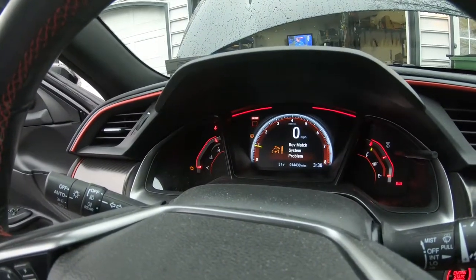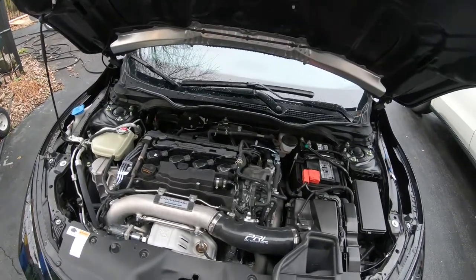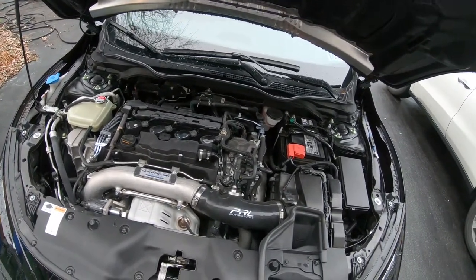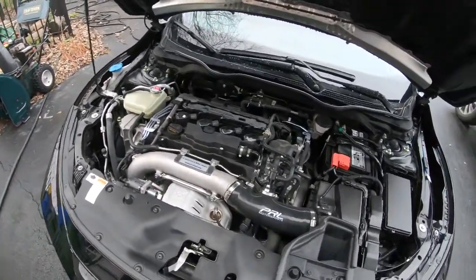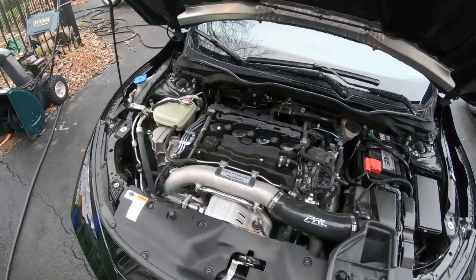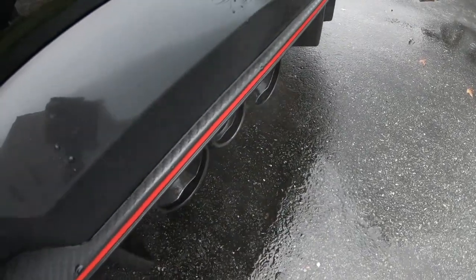Is it warmed up? No, it'll take about 10 minutes. Okay, the engine's fully warmed up. All I did was swap the spark plugs from three to four. The misfire went away — when I had the plugs out I wiped them off, put the towel over, there was a little bit of soot on them but I just wiped them off and put them back in. Now the car doesn't seem to be missing at all — it seems perfectly fine.